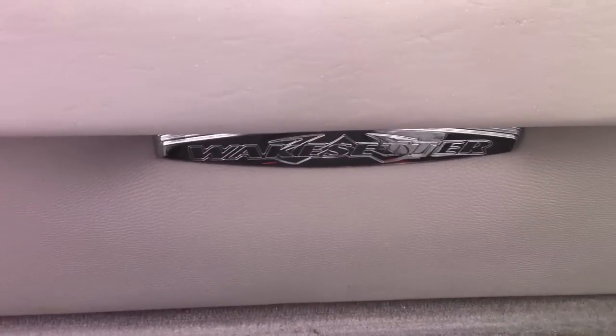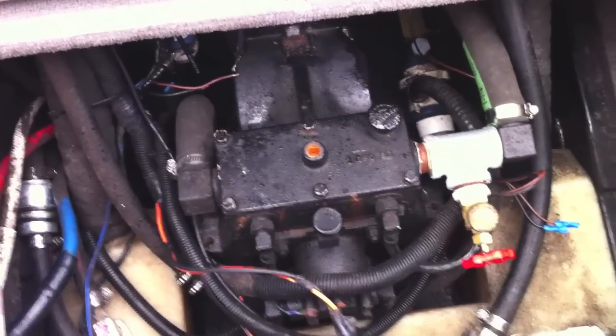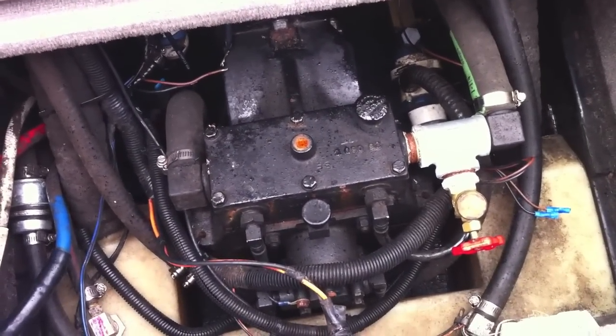When you're done, close this one, put your cap back on, and make sure you open that intake valve back up — because if you put your boat in the water and run it, it's not going to get any water and you're going to overheat. Good luck, and let me know if you have any trouble.